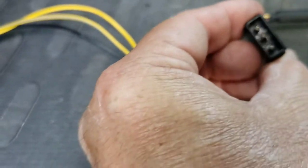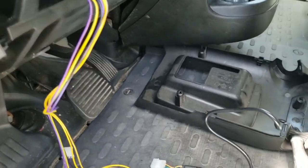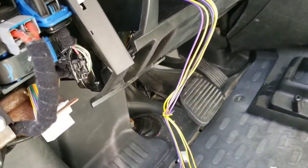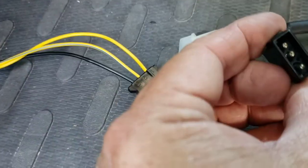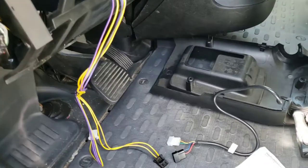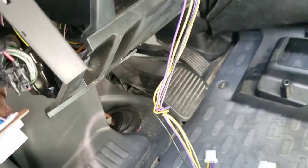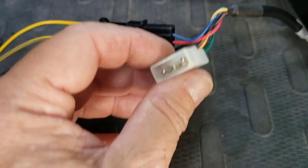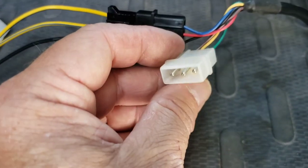These molex connectors are pretty simple to insert — it helps to have needle-nose pliers to push them in. When you hear a click you know it's in; if they don't click, it's not in. Once they're in, you can just plug them in white to white, black to black. Fish the wires back through, put the steering column on. It might be hard to plug these in sometimes because the connectors can get a little wonky — you need to straighten them out so they'll insert into the other end.